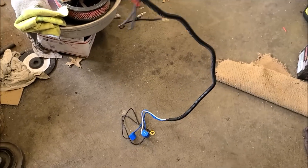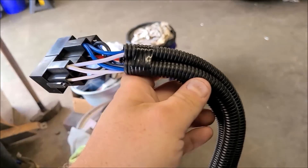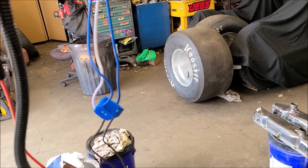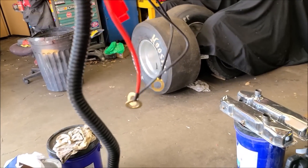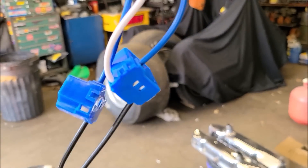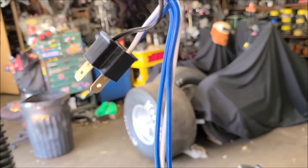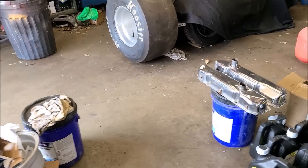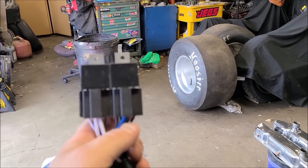This is the harness that Rob sent me and it's from Octane Lighting. You can buy these on Amazon for I think like forty-four dollars. Really nice harness — what sucks is it doesn't come with any kind of instructions, and for a guy like me where wiring is my bane of existence, it's kind of a challenge. One little Google search figured it out though. All you've got to do is supply 12-volt power from the battery — that wire right there — you got your grounds, those go to your headlights, and that one goes to one factory headlight socket. That connects everything up, and then all you've got to do is screw those in place. The grounds go to the other side. So we're gonna go wire this in and see how it works.